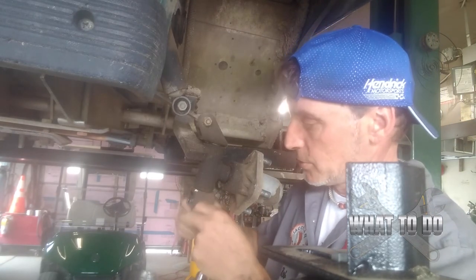Put your nut and bolt back in that hole after you take the spring out — you're going to need that later, you don't want to lose it. We're going to come over to the other side and do the exact same thing: 9/16, or a 14 millimeter, and take that bolt out.